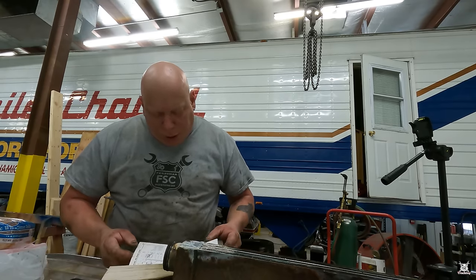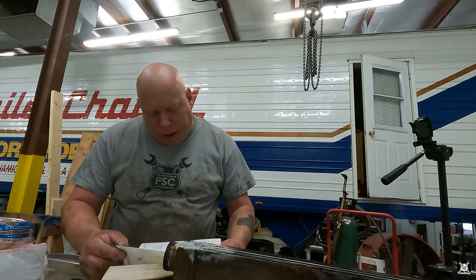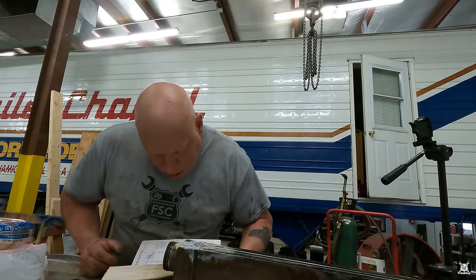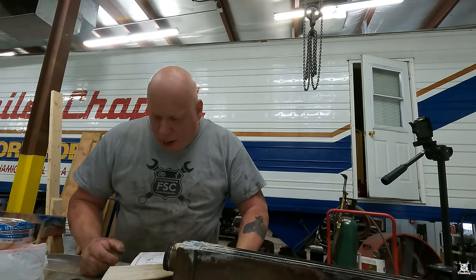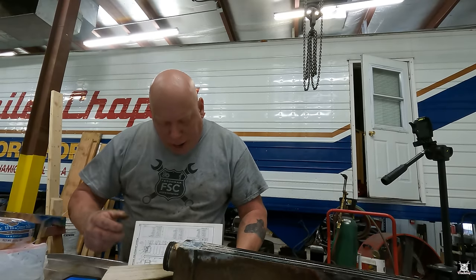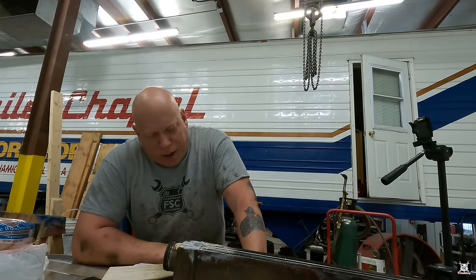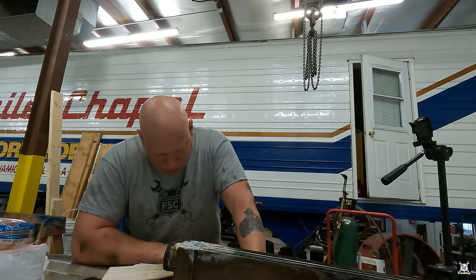Now I'm looking through an old parts book and trying to go off the serial number. Apparently, according to my parts book, there are two different ones that were available. But the problem is what I'm seeing in the book doesn't match my engine serial number exactly, so I probably need help to determine which core I need. According to my system, it brings up little yellow triangles for anything that's not associated with the serial number. Okay. I found a 1W4879. That's the core assembly for the aftercooler.